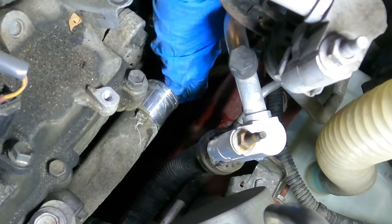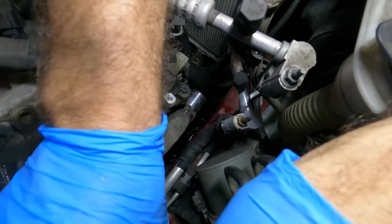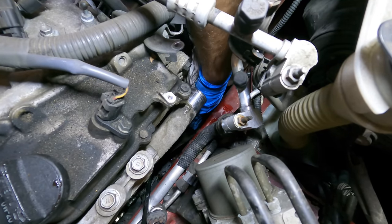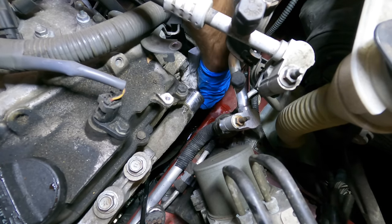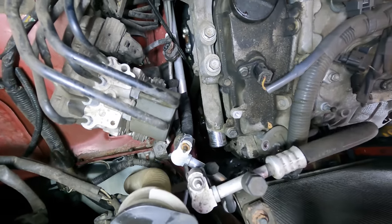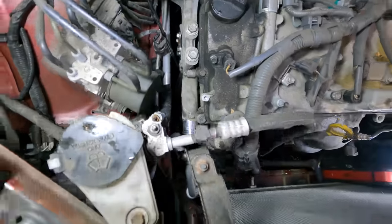Okay, now I can get to that bolt, and there's another one down there somewhere. I can feel it — it's way down. Let's untension the tensioner and slip this belt off. We'll just set that down there — hopefully it doesn't stray too far from its pulleys. You stay there. I remember last time I did one of these I struggled greatly with getting to all the bolts because of this coolant jacket thing right here, so this time I'm going to pull this motor mount off and take that coolant assembly off, then I can reach the bolt for the idler pulley and ultimately the bolt for the alternator.